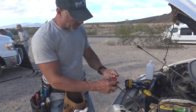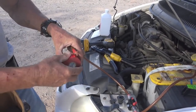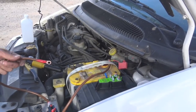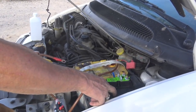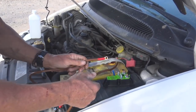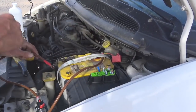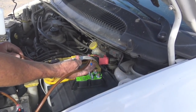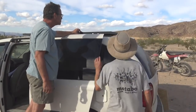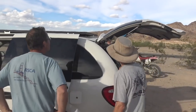We're using hydraulic crimpers and crimping a lug on this 6-gauge wire, then going to the proper side on the isolator. I'm going to use VHB tape to affix it — prep the area with alcohol, clean it, then use VHB tape. It can be taken off if needed, and I'll give enough slack with the wires for that. This is an excellent place to install the isolator — the hood closes fine, everything is centrally located, and we can get to our continuous ignition source.